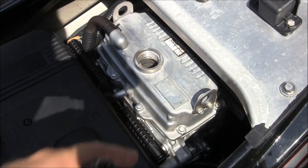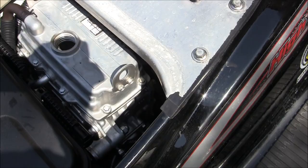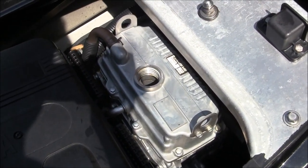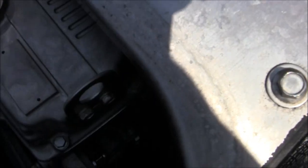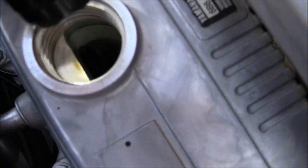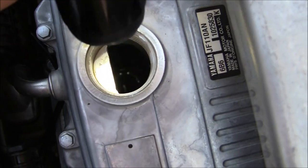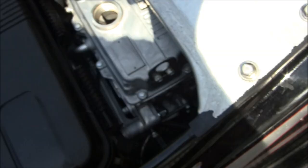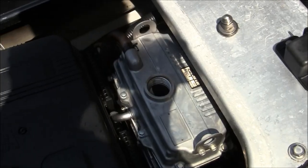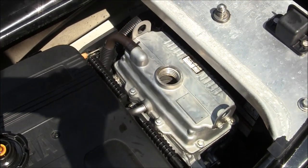You want to make sure that you completely drain the pan. There are like two levels of pan — the top level, and then there is another orifice that you have to pass the straw line into to get most of the oil out. I don't have good light, but you guys will see it. That's the one thing I want you to make sure — get most of the oil out.